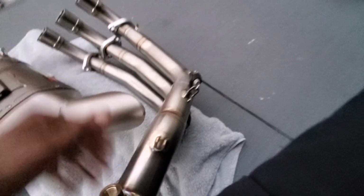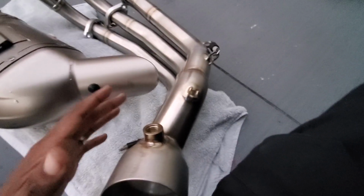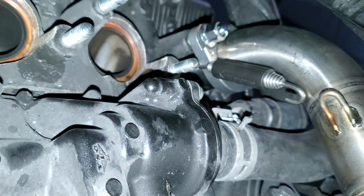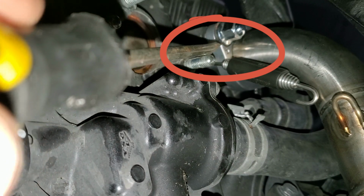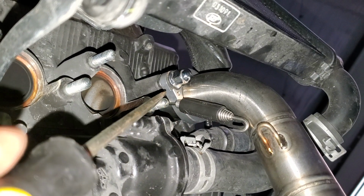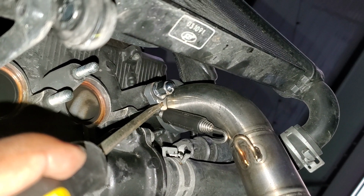I'm burning so much daylight. Guys, if you get this exhaust system, I took the gloves off because I was getting frustrated, but if you get this exhaust system, it's best if you take off the upper part and put this on second. Let me explain why. This is a short version for the bottom, but you need to put on these tall ones. So you see this little, let me move my hand out of there. I'll get the screwdriver to point. Okay, so you see this part here? It needs to hook on to this part first before you can hook this part on. And what a mission if you have all 4 hanging. You cannot get this bolt on and this pin standing there at the same time.